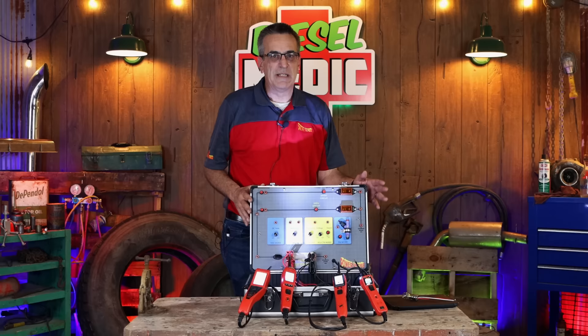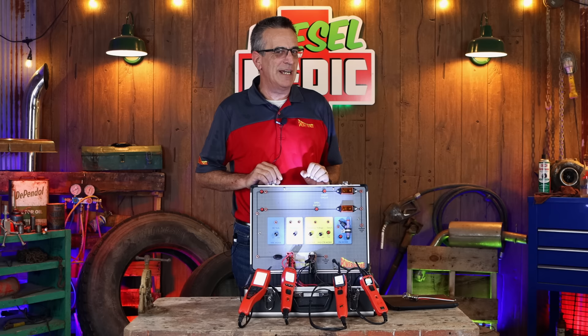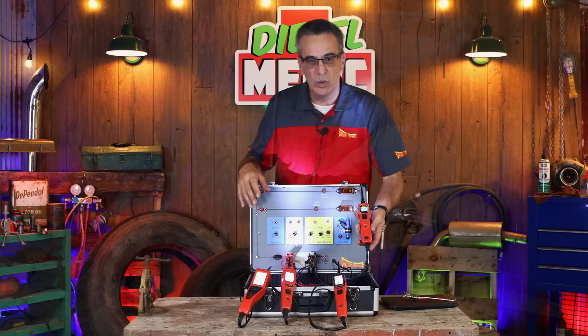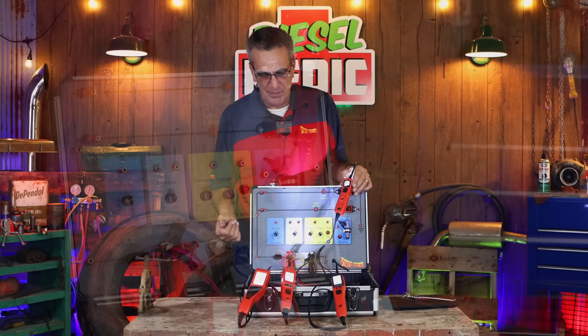No matter where I go, I hear somebody's scared of using a power probe. I've even been to some shops where they say power probes aren't allowed. You can certainly do damage with a power probe if you're applying power or ground in the wrong place. But as a master technician who's been using these tools for over 20 years in the real world, I've never damaged anything, and I'll tell you how. Number one, the testing advantage of this tool before you even start applying power and ground is huge. Being connected directly to the vehicle's source battery keeps readings accurate and looks for voltage drops from the source battery wherever you are in the car — and I haven't even started applying power and ground yet. Let me show you how that works in a real-world situation.